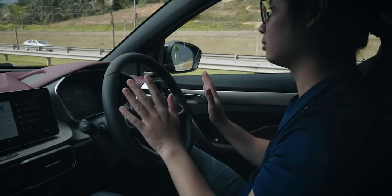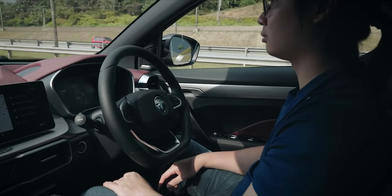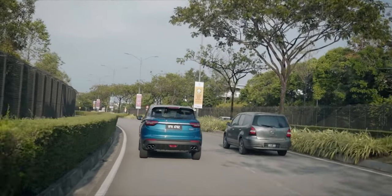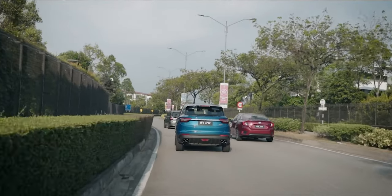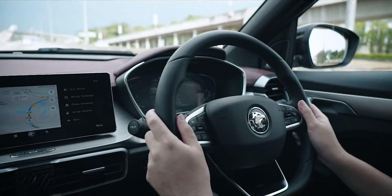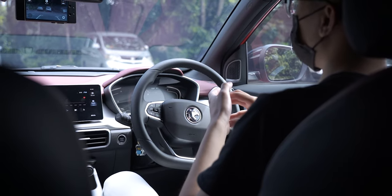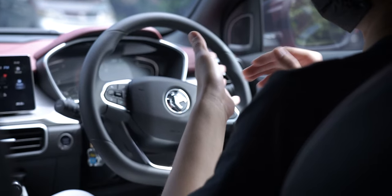This is what the original system can't do. Across all models, even if they can do stop and go, what they will do is hold the electronic parking brake, and then if you want to resume, they will prompt you to step on the gas pedal or push on the resume button. This new stop and go feature, we just released it in version 7 of our software.